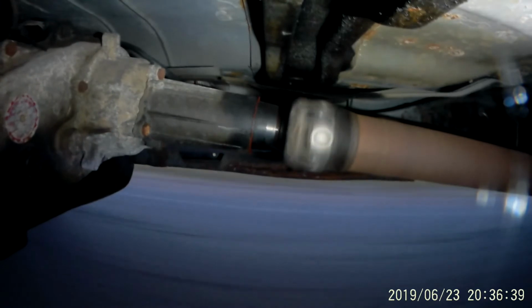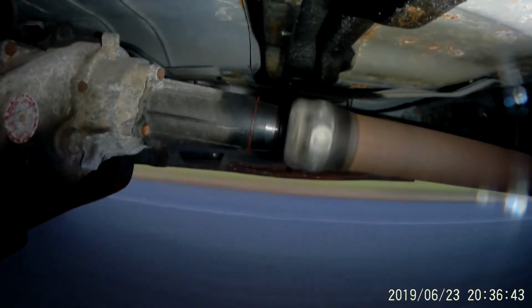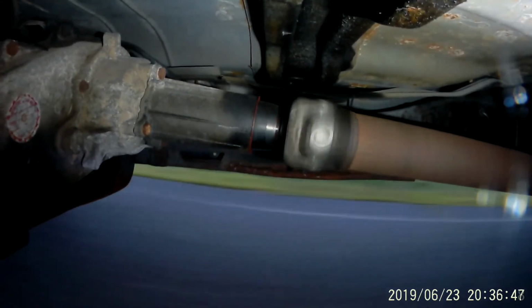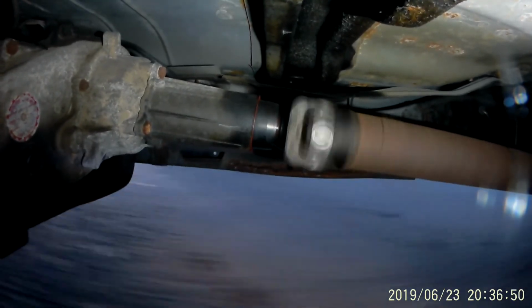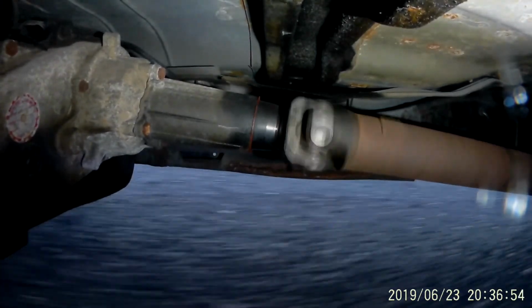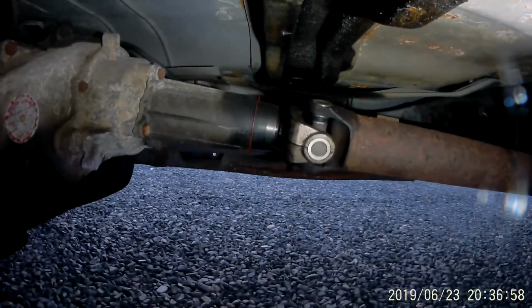I hope this video was of some help to you, especially if you're having an issue where you feel like something isn't shifting into gear with your transmission, but maybe your transmission is okay. I found that this is most likely due to bad motor mounts and maybe even a transmission mount. I will likely be replacing them and will follow up with some after footage to hopefully see a good comparison after the fact.